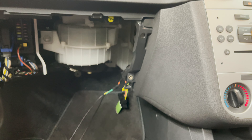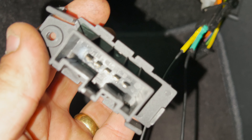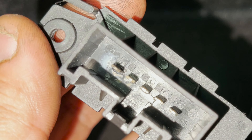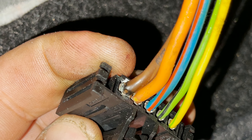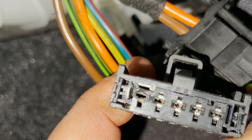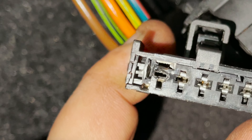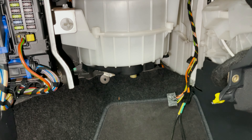Anyway, the problem in this car - if you look at the resistor, you can probably see the main ground connection is kind of burnt. It's the fifth pin on the left that's burned. When you look at the plug itself, that brown wire which is the feed to the motor is all burnt up, and the actual plug connection on the left is all burnt as well. So there's high resistance on that connector and it's unable to give the right current for the motor to work.